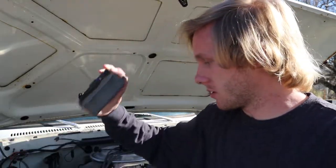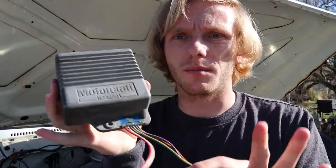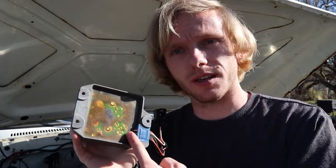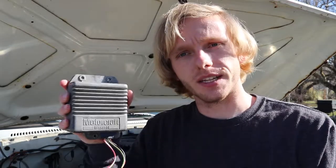We're going to go through no spark for the DuraSpark system, in order of most likely causes. No spark usually is going to be the DuraSpark box — the DuraSpark 2 box. I have my original right here. This is the DuraSpark box that everyone hates — they're really not that bad as long as you set them up properly. In the back you see potting material; when these get really hot this potting material melts out, and the number one killer of these is heat.